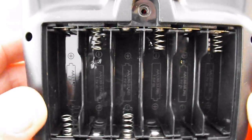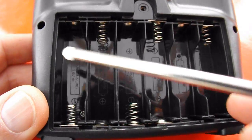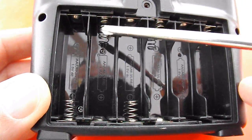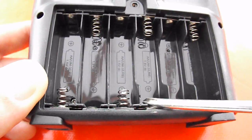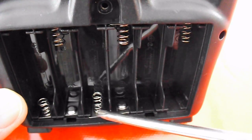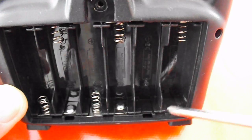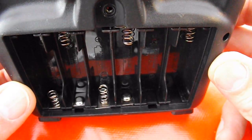The metal contacts are missing. We're in close-up mode looking in the battery compartment. If this is all that's wrong with it, this is going to be brilliant. We've got positive contact up there, negative contact there on a metal strip that connects across. That negative connects to that positive, which goes to that negative, which is on a metal strip that goes to that one — and look, we're missing a piece. We need another metal plate with a spring on it. I'm pretty sure I should be able to find one, and if I can't I can make one up in a matter of minutes. If that's all that's wrong with it and that's what made it half price, I'm more than happy.